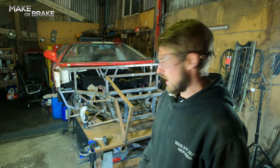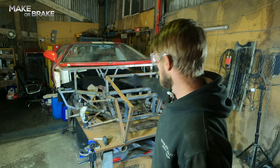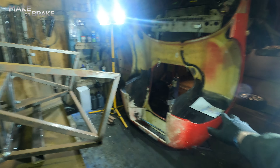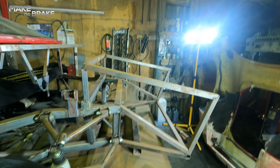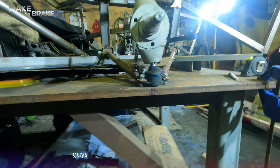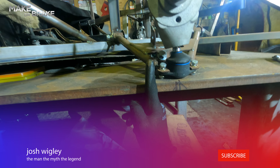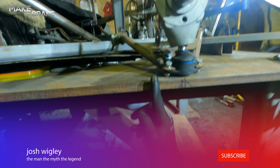At the moment we are around about 60mm out. To rectify that, I'm just going to buzz these spot welds off that are fixing our front end. We're going to take these pieces out, buzz those little spot welds off and slide the front end down out of the way. I'll then offer the front clam back up onto the front of the car, get it packed off and square where it needs to be, get our lines about right, get our door shut about right, and then mark the centre of the wheel arch with a sharpie onto the building table. I've already got a reference point as to where our current wheelbase ends, so when I put the new clam on there will be another mark — that will become our new centre of our front spindle.